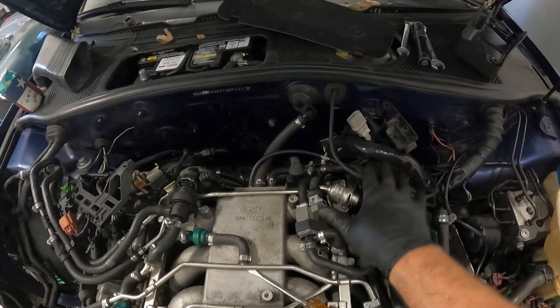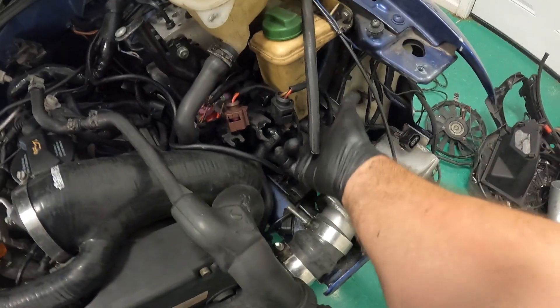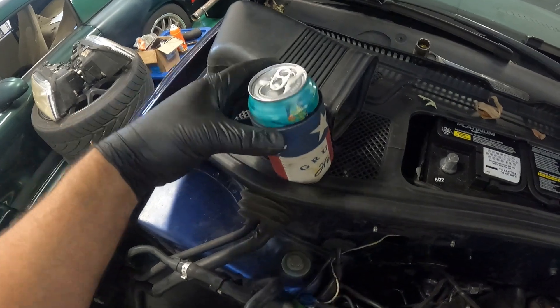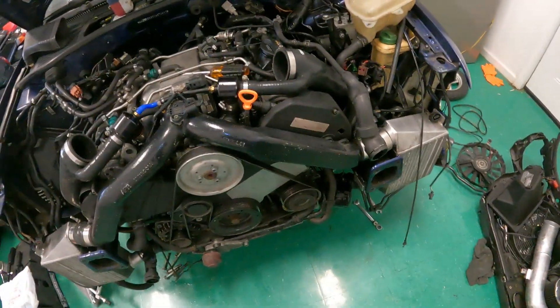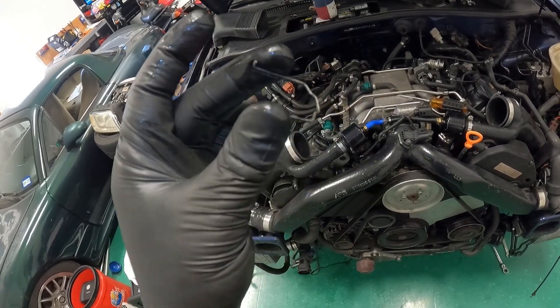We have got all of the down pipes disconnected and all of the transmission bolts out. Now what we're going to do is get back here and disconnect the coolant lines going to the back of the block, disconnect the power steering system, undo the wiring harness, undo the motor mount bolts, and we should be able to lift this thing out. These are going to have very similar clips to what's on your core support — just a little bit smaller — so keep track of these or your hoses will not go back on correctly.